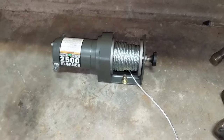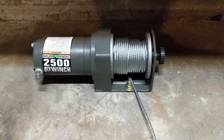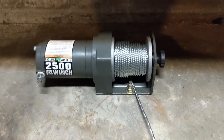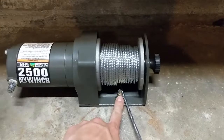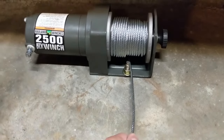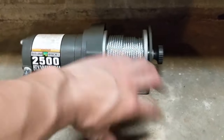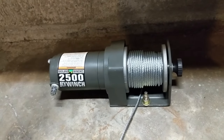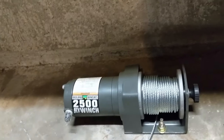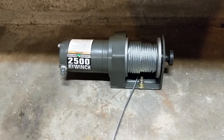The winch is finally installed. In the next video, I'm going to show you how to wire it and we're going to test it. I did notice a problem with my winch install — the way this bolt sticks up, it's obviously going to catch the cable and that's not good. So I figure I have two options: I can either cut this off flush right there, or turn the winch around and use it the other way because it'll still function just fine and that'll actually give me a little bit more height. I'll look into that and get back to you in the next video.